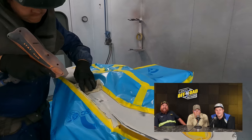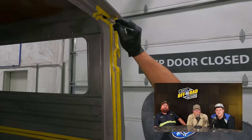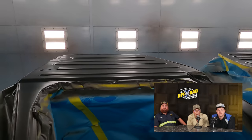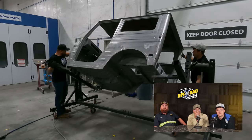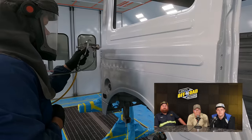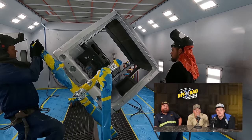This is just the first part — it hasn't started yet. What I'm doing is getting ready to put polyester primer on the whole thing. Running the seam sealer. We've got it all guide coated, so after this we'll block it all down, then we'll put actual primer over top of it. Then we'll prep that all down with 600 and then we'll be spraying gold. Now we're going to flip this body, seam seal the underside, and start getting this thing jammed out.